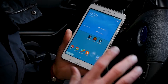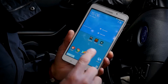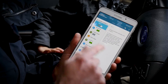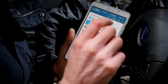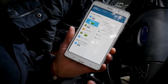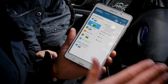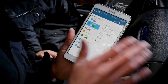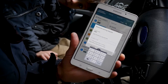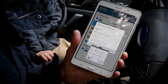Next, connect your OBD2 reader to your Android device. Download the Torque Pro app from the Google Play Store, then go into your settings and connect to your OBD2 reader via Bluetooth. What I found — particularly in my Ford Ranger — is that if there are multiple Bluetooth frequencies in the vicinity it can mess with connectivity, so turn everything else off first. Once you pair, you'll be asked for a passcode — it's either four zeros or 1234. In my case it's 1234.